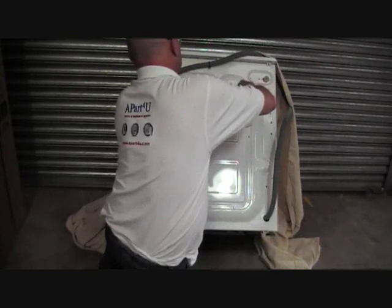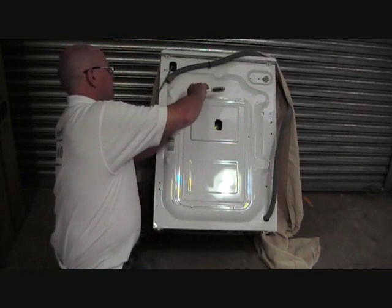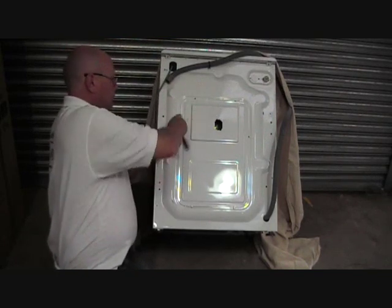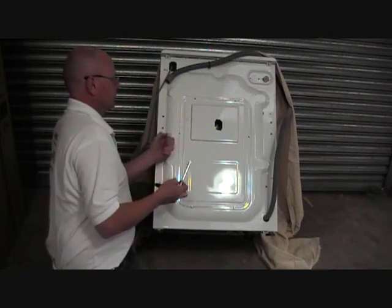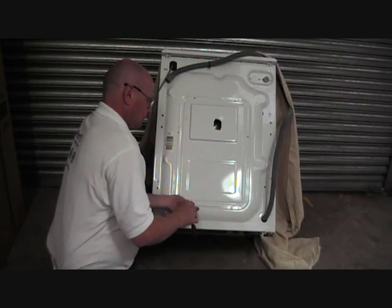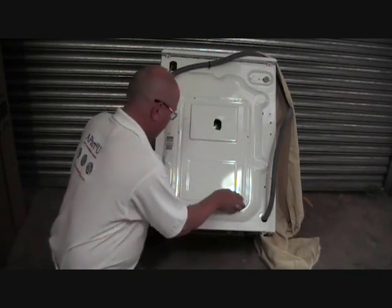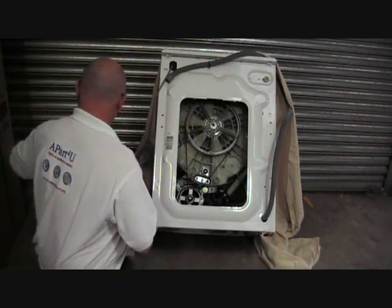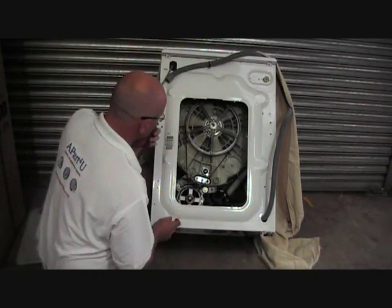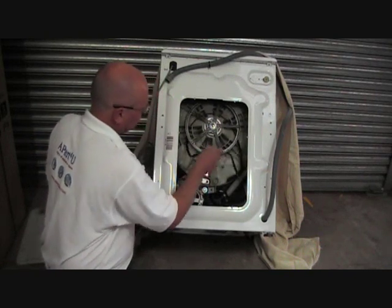This video can be used for an assortment of appliances. Most motors are fitted on the bottom of the machine. There are 3 different types of fixings. There's usually 2 bolts that hold the motor in place, 3 bolts, which is a sliding bracket which allows tension to be placed on the motor, or 4 bolts. This motor has actually 2 bolts with 4 locating lugs.